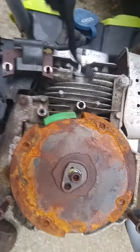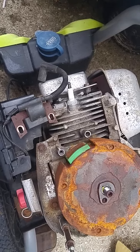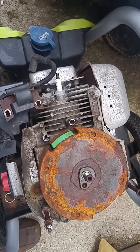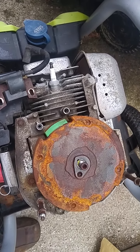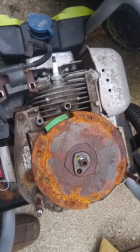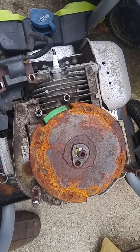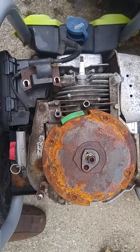it's looking like the issue is probably the exhaust rocker arm — that seems to be pretty consistent. With this other EG 3500 going, I'm thinking I'm probably going to weld that if that's the situation. But I'll see — valve lash. Hopefully it's valve lash, that'd be nice. Anyways, call it good.